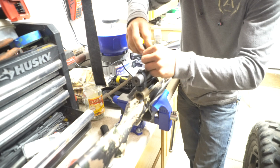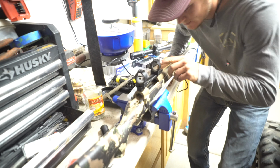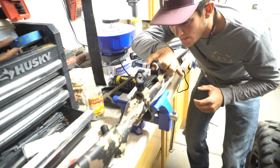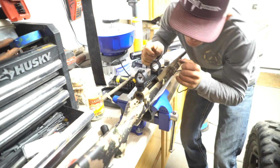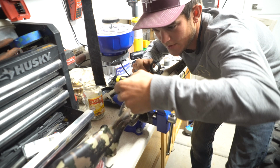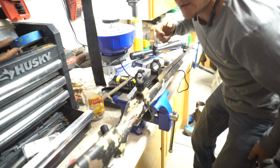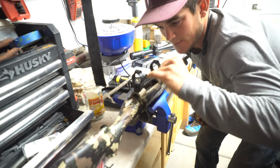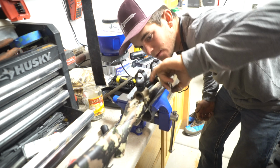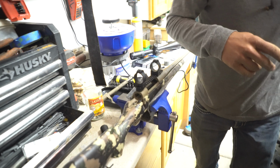Take this lapping bar out. And can inspect it. So what it's doing is that you can visually tell when they're black like this. You can tell when it's taking the anodizing off of the rings, and you can see that it's wearing down the high spots. It looks like we have good contact all the way through. We've got it just barely wore down through the anodizing. Take and wipe that out with a rag.